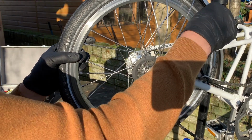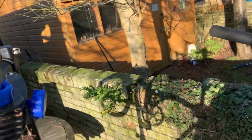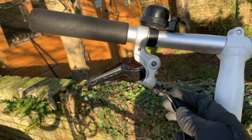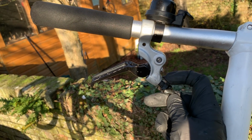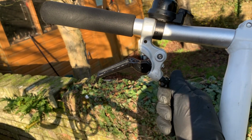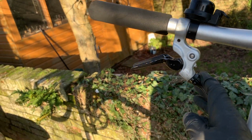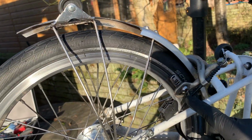And I don't know if there's enough brake clearance. So tell you what, I'm being a bit lazy and I don't want to take the cable off the brake if I can avoid it. So because there's quite a bit of wear on the pad, I've got this one backed right out. So I'm just going to screw this back in. This is for the rear brake pad wear adjuster. And hopefully that's given me enough extra clearance here to be able to drop the wheel out.